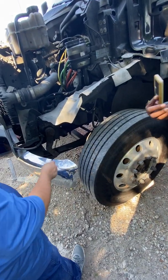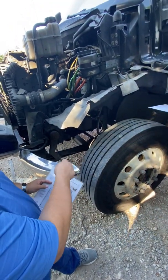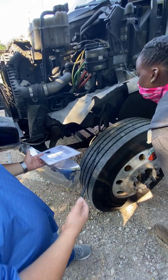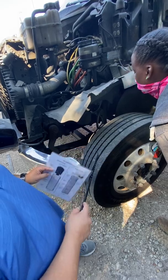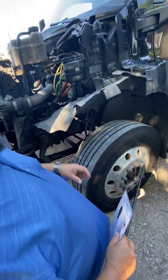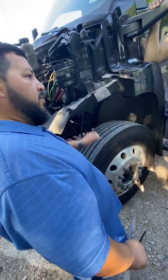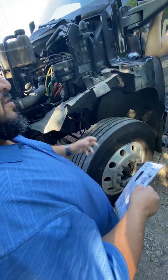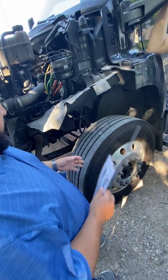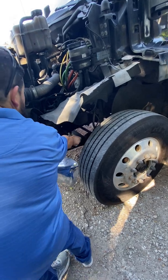Yes, it does have a lot of nuts and bolts holding it here, there, and just pretty much at every joint. So we're going to check that all of those are tight so nothing's coming loose. Condition, make sure nothing is cracked or broken so everything works correctly. The joints do have to be also full of grease, so we'll make sure they're full of grease so they don't wear out fast. And if we grab those parts and we try to wiggle them around, again, we're looking to make sure that there's not a lot of play there, because that could also cause us to lose control of the truck there as well. The steering linkage, that's all you got to remember. And just most important, do this with the stick. That's it.